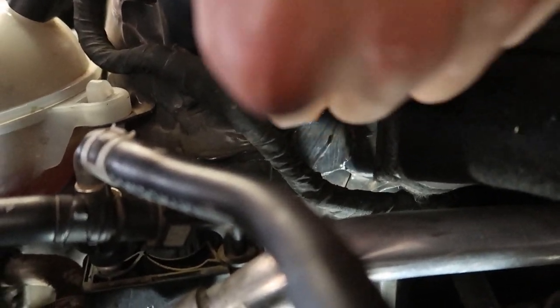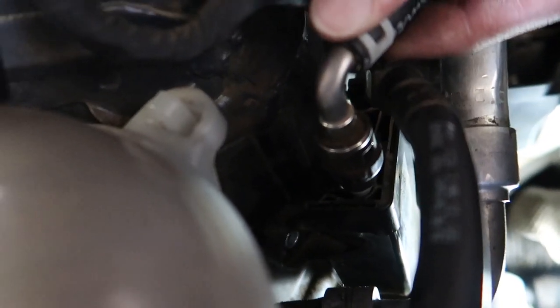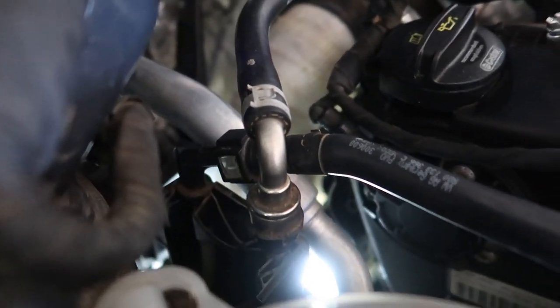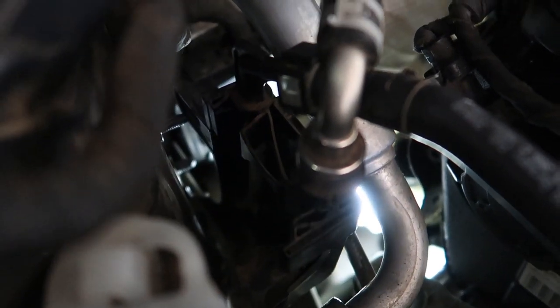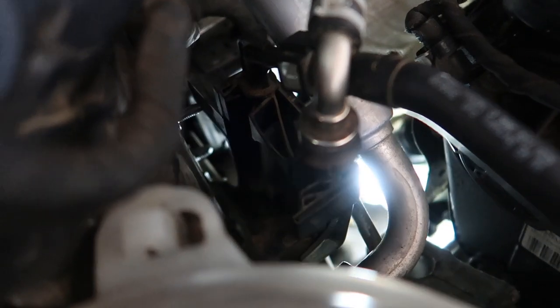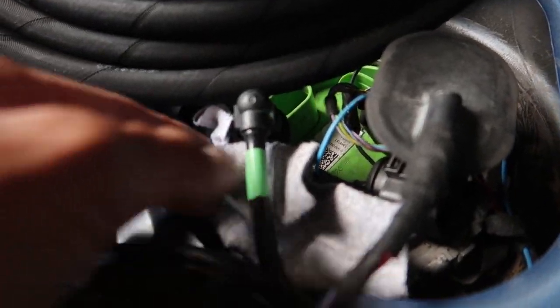It's a little cramped in here. Looking at the passenger fender: here's your ABS module, here's the downpipe. That 13mm bolt gets the whole heat shield loose — I can't fully remove it but it should make things easier. Then there's a 10mm on the black plastic piece. Get that 10mm off and this whole thing comes out. We're going to detach the fuel line from right in there and run the new line back through this plastic to keep it away from heat.